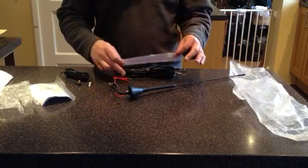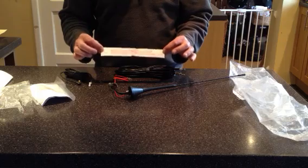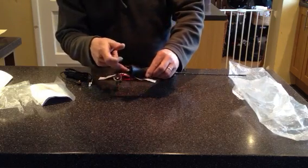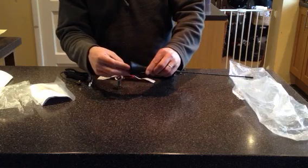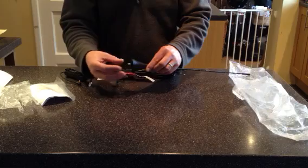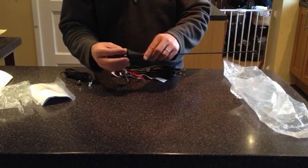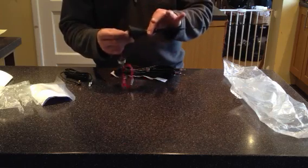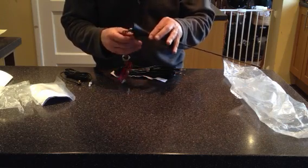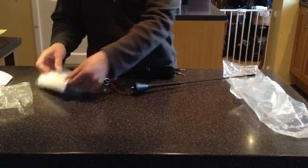This was attached around the cables of the antenna. It's just warning you to make sure you use plenty of grease when inserting this to the car. Make sure it's full of grease around the inside here when you put the cable through. This will ensure the lack of corrosion on both the bodywork and the metalwork of the antenna on the unit here. It says that you need to put enough in that when you push this down the car and tighten the clamp, it squirts out the side. If it's not squirting out, you haven't put enough on. So that obviously just protects it.